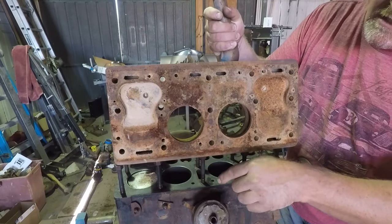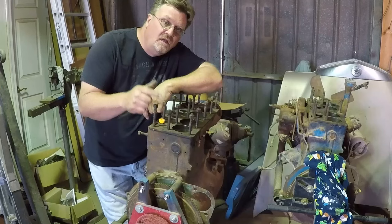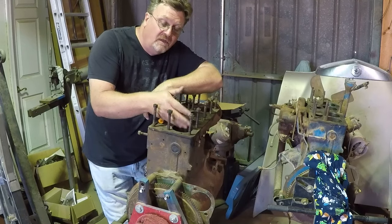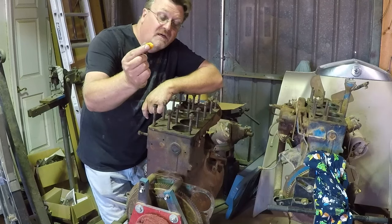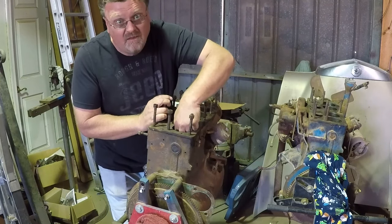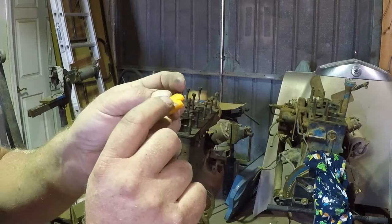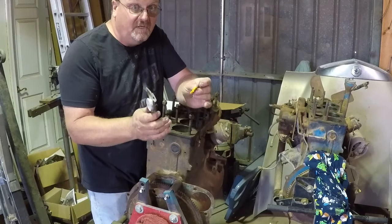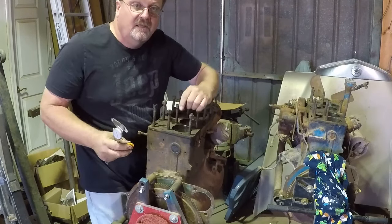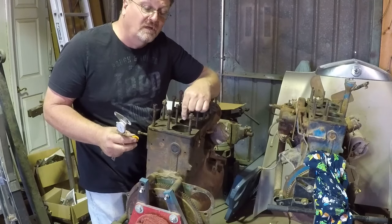This is not mine — I actually got this motor from a buddy of mine who just wanted the cylinder head and gave me the motor because it was junk. But I borrowed this just to show you because I think that's neat. Now this block has a really deep gouge, and I'm not sure whether boring it is going to clean it up, so I want to measure it. Obviously I'm not going to get a measuring tool in there — I'll show you a neat trick: steal a lump of your kid's Play-Doh, try to pick a color they won't miss, take the Play-Doh and make an impression of the gouge in the wall, press it in there good, peel it off, and you have something to measure. I'm looking at about 14 thou, which is good — because these are standard sized pistons. 14 thou on the radius means 28 in diameter. I think this will clean up with a 30-thou overbore. It definitely should with a 40.